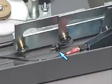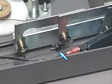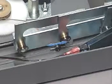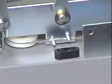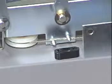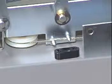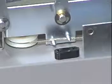Insert the screw with the ends of the cable into the rearmost hole in the left shuttle carriage bracket. Install the nut on the screw and make sure the cable ends are straight and tighten the nut. Insert the cable clamp screws in the right shuttle carriage bracket and route the cable so that it passes under the rear screw and over the front screw. Install the clamp, but do not fully tighten the screws.